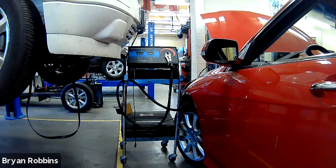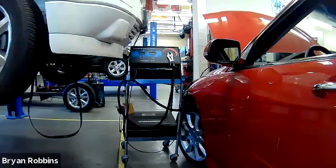I'll crank the engine one more time to see how high the amperage goes. My cord had become unplugged from the amp meter, so I did it one more time to get a good amperage reading. I got my reading, and I'll say it was over 100 amps — I'm not going to give the exact number so you can go through and do this test yourself. That's a starter motor draw test on this Acura: we're seeing how low the voltage goes and how high the amperage goes while the engine is cranking.